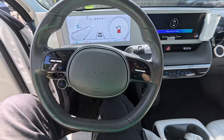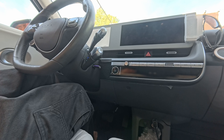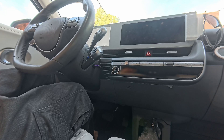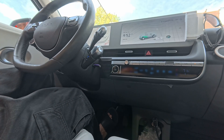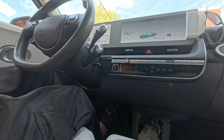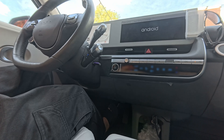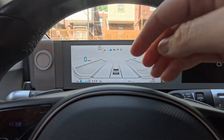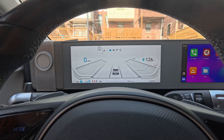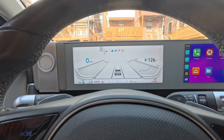After you enter the sequence of buttons, go ahead and turn the car off by pressing the start button. Now that the unit has been fully installed and the keys set up, let's try to start the car as if you are a thief: press and hold the brake, press on the start button. Let's try to shift it out of park — and it doesn't work. It will automatically shift back to park immediately. We are in park, shifting out of park will immediately jump back, engaging the emergency brake. Pretty slick.